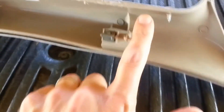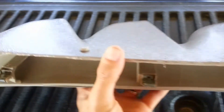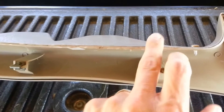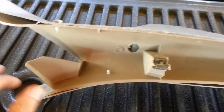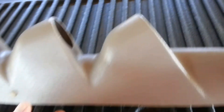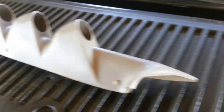What I did was I trimmed about a half inch off the front side that goes towards the windshield. Then I put three screws that came with the GlowShift gauges, and I also glued it — because you'll notice when you put this in and actually mount it into the truck, the GlowShift portion was bulging in three different places. By gluing it, it's going to give it a nice clean look.